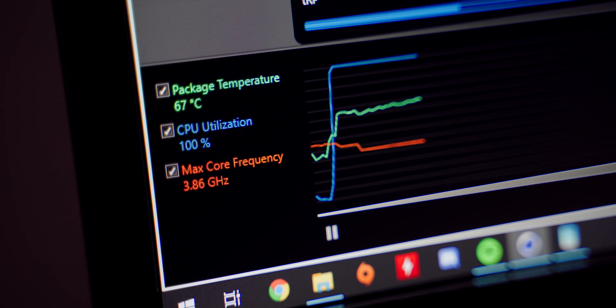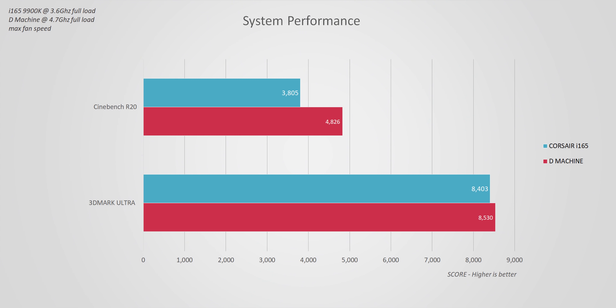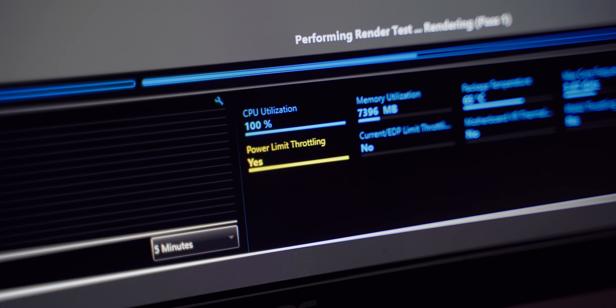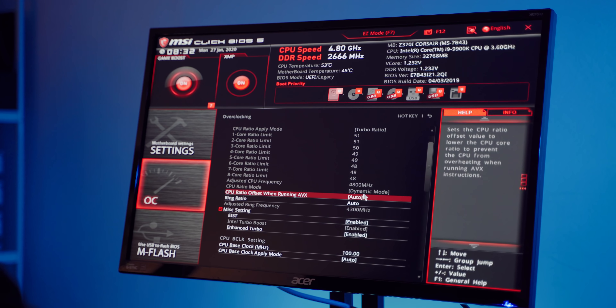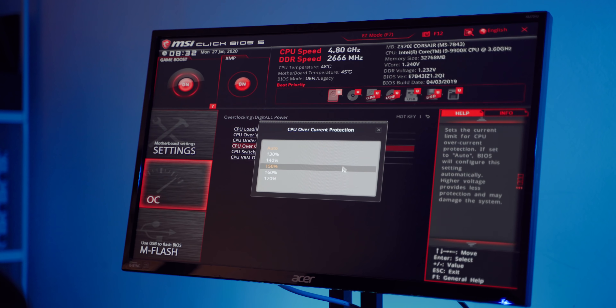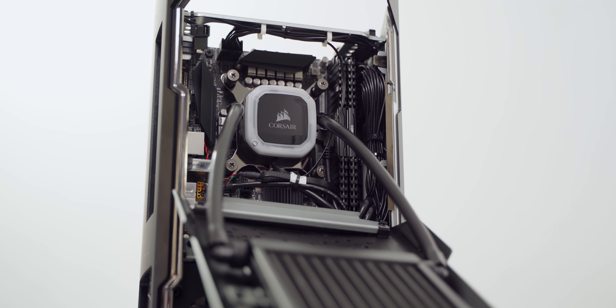As for CPU performance in-game, it's fine — reaching 4.7 GHz — but in Blender, for example, we drop to 3.6 GHz even though there's enough voltage. By default, CPU performance outside of gaming is slower because my own machine clocks to 4.7 GHz and beyond easily during intense renders. It looks like the motherboard on the Corsair One isn't able to deliver enough power to the 9900K to stay above 4 GHz at full load. Overclocking is only partially available in the BIOS — I increased the power limit and got to 3.9 GHz on all cores, but it's still locked to a 95-watt power limit by the motherboard.